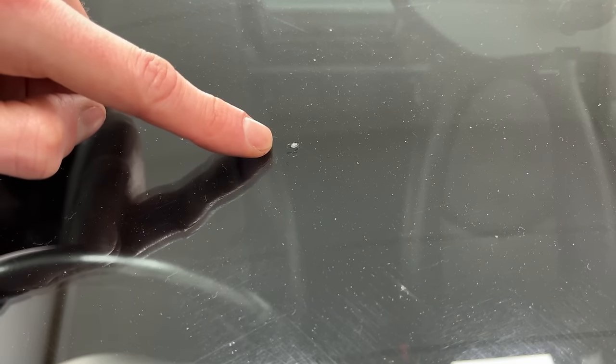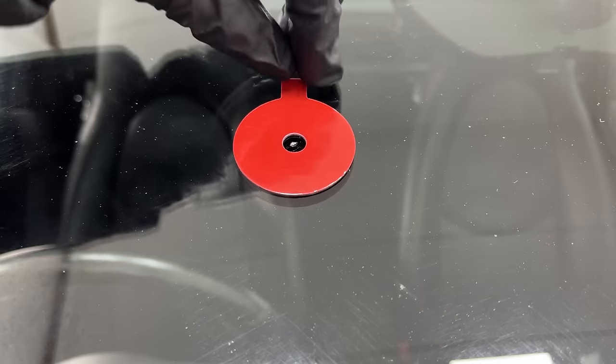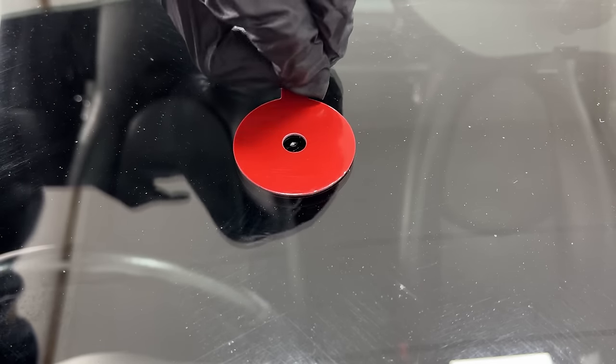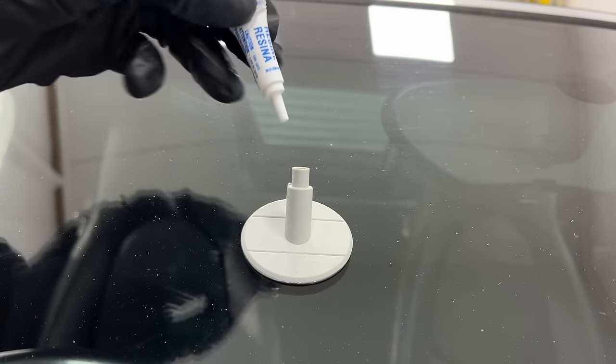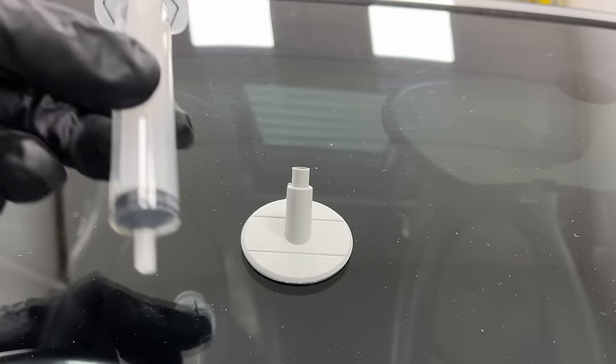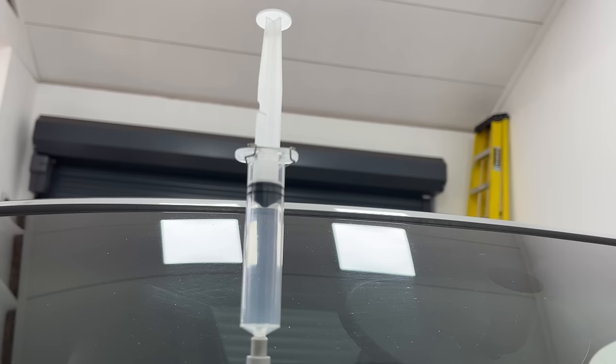Here's the crack in the windscreen I'd like to repair. It's not enormous but it's right in your line of sight — you can see the steering wheel just here, so it's very distracting. Here is the kit I'll be using; I'll put a link in the description box if you want to get one yourself. First up we need to get the area nice and clean and grease-free with this little alcohol pad. Once dry, we need to stick this little sticky pad over the hole, then peel the other side of the sticky off. Then we fix the little dome-over template. Now it's time to put the resin inside — pour in about three quarters. Now we need to suck all the air out, so we'll put this syringe in here and then pull up and lock it. We now need to wait ten minutes.